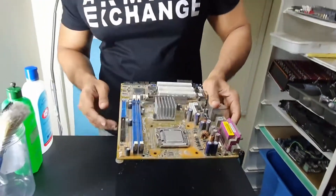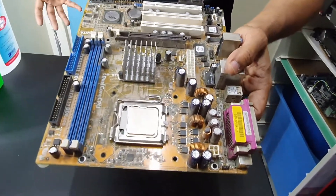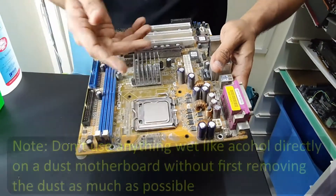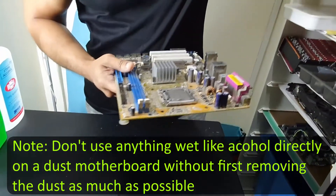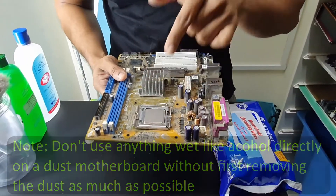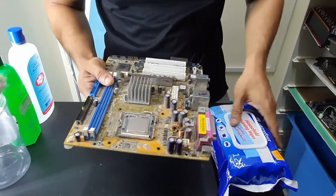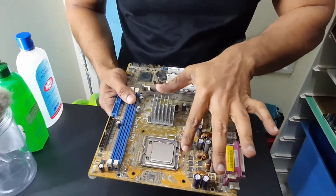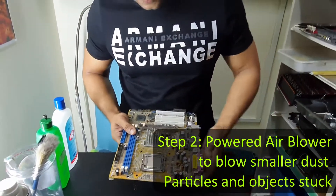Just by sucking — because that machine is really strong — as you can see, a lot of the dust is already cleaned up. Now imagine if I had gone straight in with a wet wipe. If I used wet wipes and started cleaning that dust, some of it would get picked up, but then some of it would get stuck there with the alcohol. When it dries up, it's going to form a greasy situation and it's going to be very difficult to get out of those areas. So it's best to suck the dust out first.